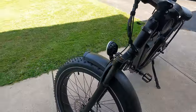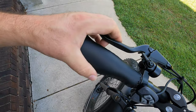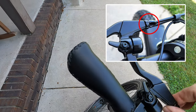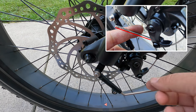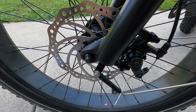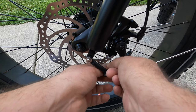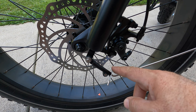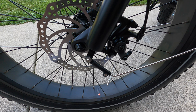What that'll do is make this brake lever nice and tight. You can see we picked up all the slack — that's actually pretty good — but we can make some fine adjustments by backing this off a little to give a bit more distance. I'd like this wire to be a little bit shorter, but I don't have any of the little end caps and I don't want it to start getting frayed. So for now I'm going to tuck it over here, and I'll probably cut it down and grab some end caps to crimp on the end so the wire doesn't fray.